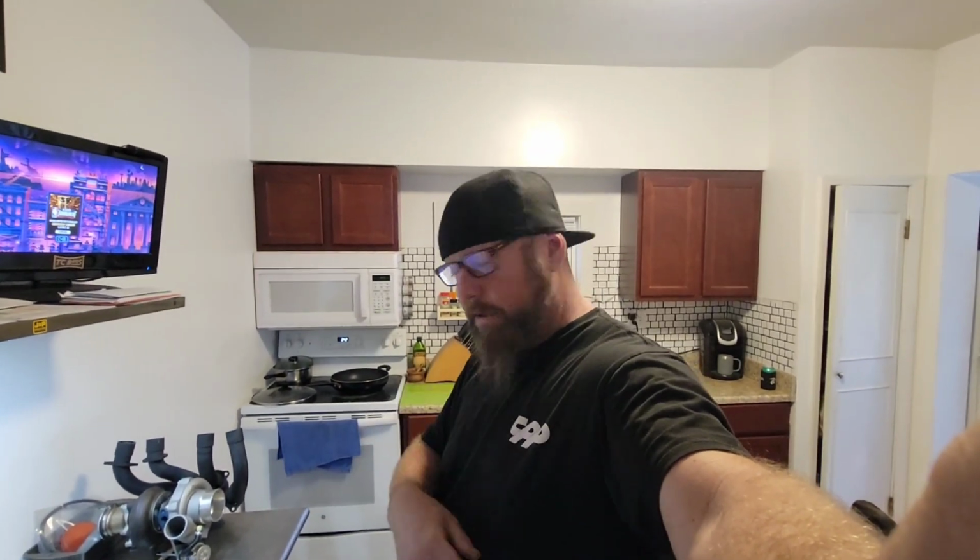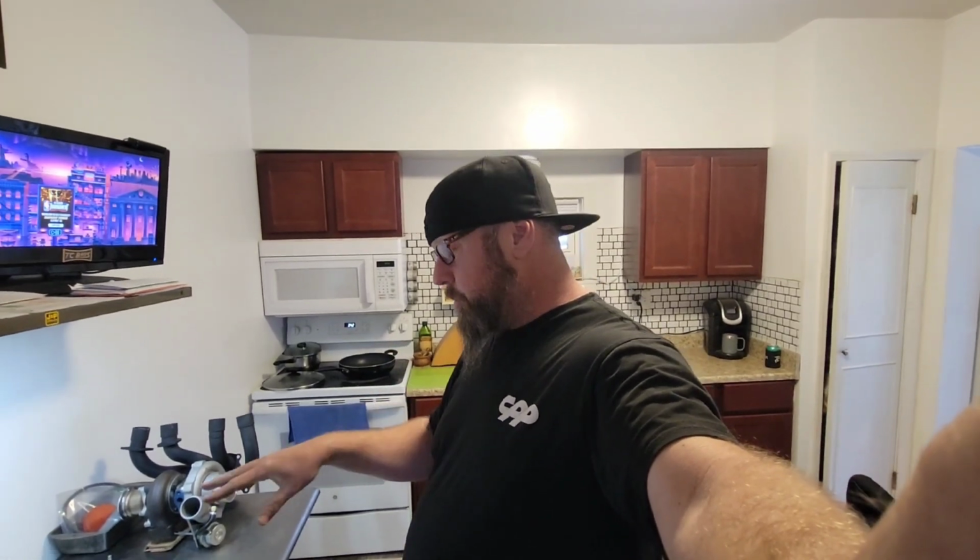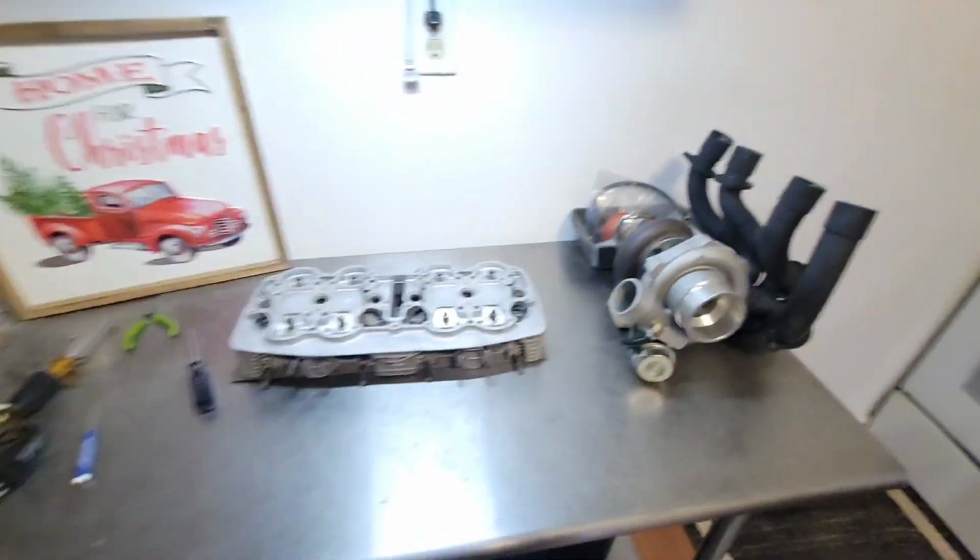They don't like to have a lot of oil in the bottom. The oil that's in the engine, it's moving the whole time. It's going somewhere up and around or back to the tank. That's the way they work the best. So if you just restrict a little bit to what you want to control, that works out fine. Works out real good, actually. That's all stuff Honda figured out. That's not stuff I figured out. Don't blame me.